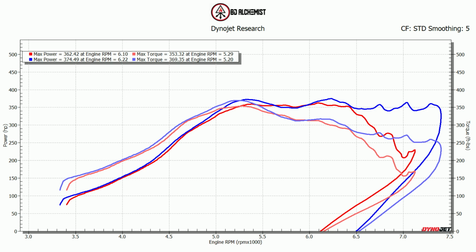Just way too rich at this point. This is his spool up area because I think he hit like 18 pounds on that one, and you know, it's kind of tricky to do spool up on certain turbos because sometimes it just immediately goes into the boost, but we'll work it out.